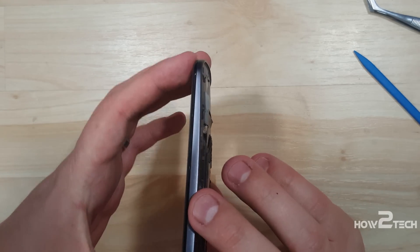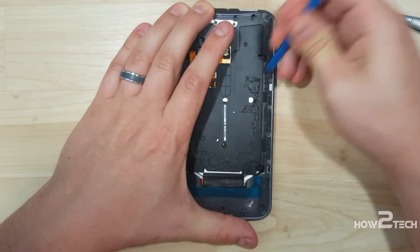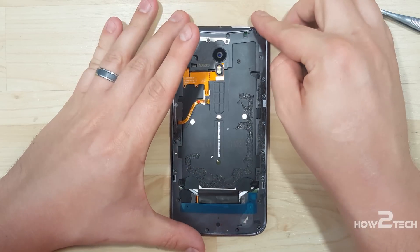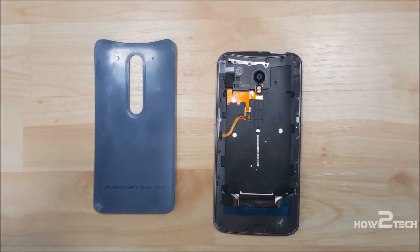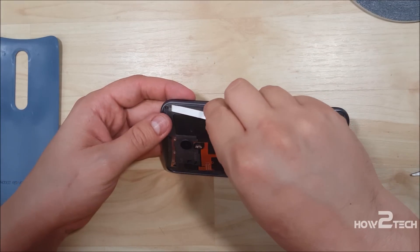Check around the edge and make sure there's no issues and it's nice and solid onto the frame. Now we're going to scrape all the tape off — remove all residual tape before you start putting the new tape down. Just work your way around the phone, and use some isopropyl alcohol if you have any residual tape mess you can't get off. Make sure you remove all the tape from the back of your back cover as well. We're using some 5mm width 3M double-sided tape — I'll put a link in the description.